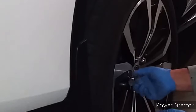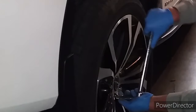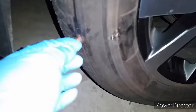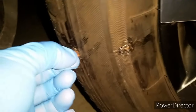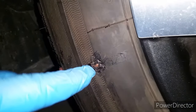The next day I came by and checked and the air did leak out. I thought the patch was bad or maybe the valve stem was leaking, but neither of those were the problem. What happened is that when the nail went through the sidewall, the tire went flat enough that the nail poked another hole. I had a hard time finding that little tiny hole, but eventually I found it. I took another strand and plugged up that second hole as well. Here's a closer look — they both sealed up and the car has been driven for a couple of weeks with still no leak.